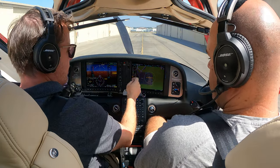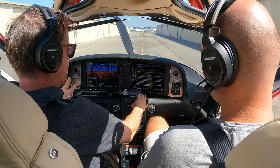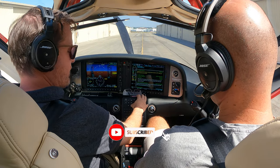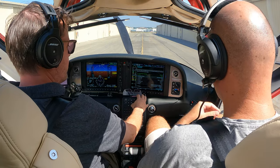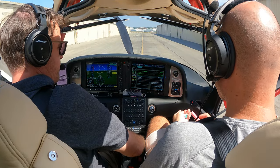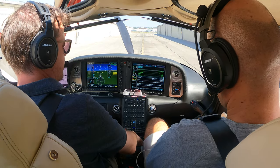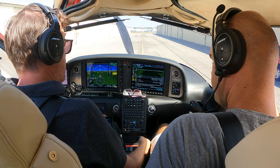Okay, let us commence. I did an external pre-flight this morning. Weight and balance, we talked about that. Emergency equipment is on board. Passengers have been briefed in the past, and seat belts are fastened and secured. Brakes are going to be held here, and battery switches are already on. Strobe lights coming on. Okay, cold start, so we're going to quarter inch. Mixture cutoff. Propeller area is clear. Pump is coming on, and we're going to prime the pump.